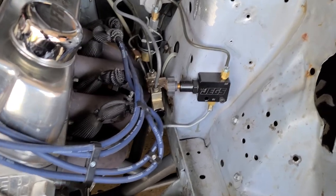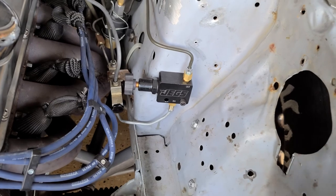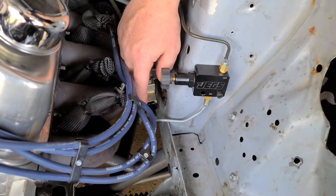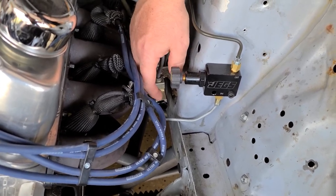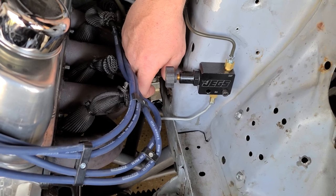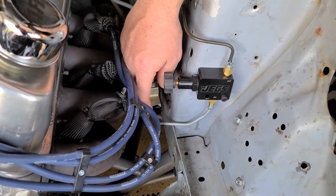Well, he's got the new one now. He was able to slide that piece out, and basically it's open just a union now, right? I'm not plugging anybody specifically. I'm sure there's 1,000 kits out there for these, but Maxim Motorsports, if you go on their website, they sell a kit, and all you do is basically you take this nut off. It's a 19 millimeter nut. You pull it out. Be careful, because there's a spring behind there that's going to try and push everything out. There is a little bit of fluid that comes out of here.